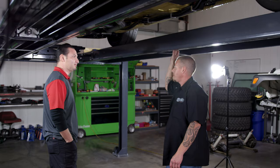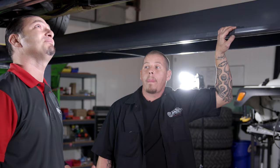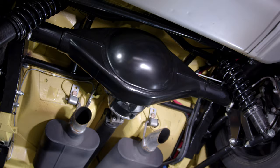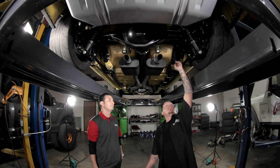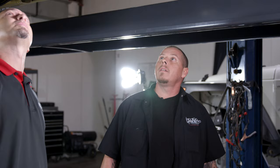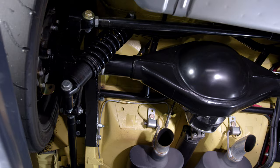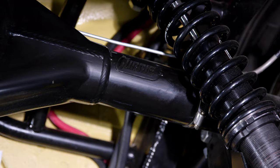Are you going to autocross this car? That would be the plans — I'm sure it's going to happen in the near future. It seems like it's built for it. So I'm going to guess this four-link is all your design? Yes. You've done some unique stuff to it — there's some crossbars up through there. With the horsepower, this being a unibody car, I wanted to make sure everything didn't fall apart and taco on me. So I actually made some frame rails right here and started bending tubing up in the middle so everything stayed square and strong. You've got bracing through here and tubular stuff coming over the top — it completely goes one side to the next, it's a one-piece deal that just slides up in there. Drill a couple of holes and you're good to go — no welding necessary. A guy doing an install in his garage could just bolt this on.